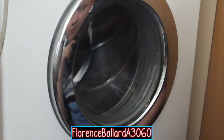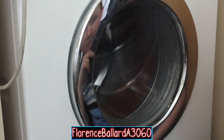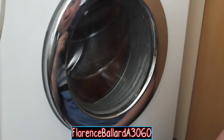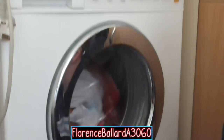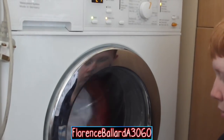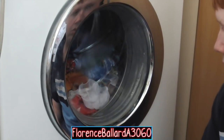This machine would normally now go onto the final rinse. This machine's a default 2 rinses, but Water Plus is added. So this one will stop and it will tumble back and forth probably because it's now got to switch it from the drawer back to the door. There, it's trying to chug, I can hear it. It might do a bit of anti-tangle there, see, tumbles a bit. Oh yeah, so it's changing it. It's changing because the machine's realised I'm going on to the final rinse now, I've got to go back to a normal rinse. And that goes back.